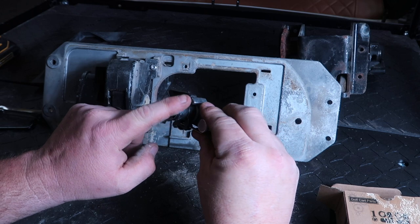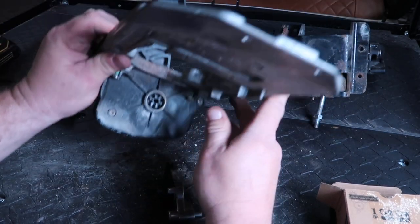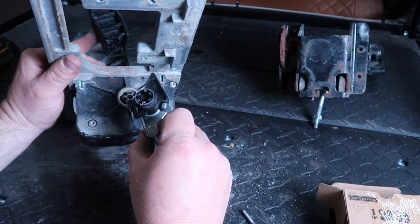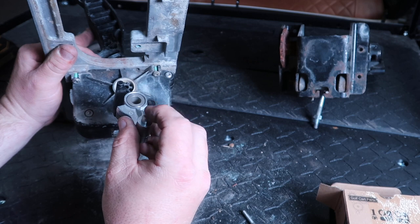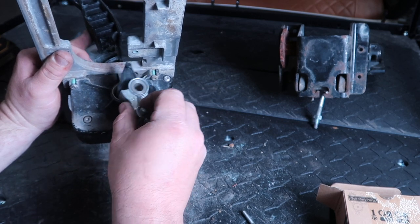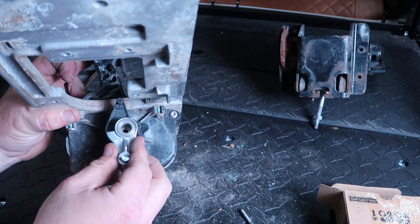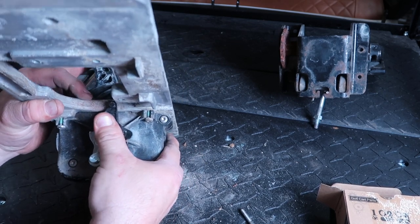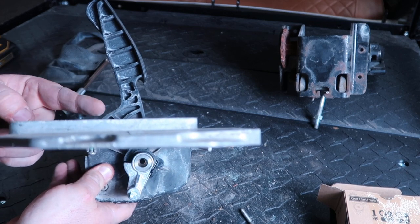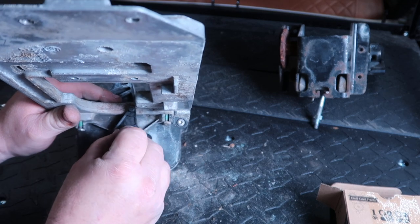I will say this as well — on the outside of this assembly, this also acts as sort of like a bearing where, if you look at this portion here, it's actually connected to the pedal itself — see, it's turning there. And when you're installing this piece back on, you want to make sure that this little silver piece on the bottom is just slightly over this one notch here — so almost perfectly straight up and down. There we go, we got it installed. What I had to do was actually lift up on the pedal itself in order for the pedal side of the rod and the gears in here to fit perfectly. Now I'm going to go ahead and replace our bolts and tighten it down.